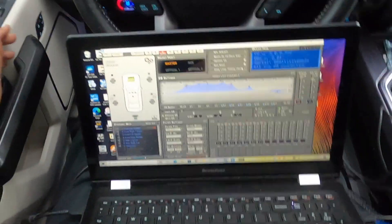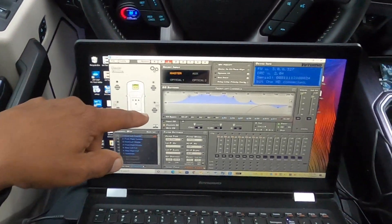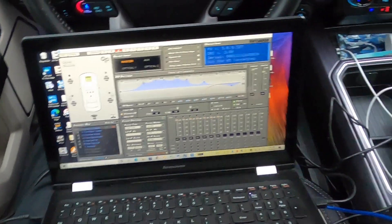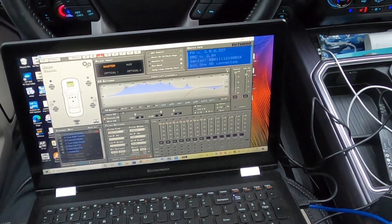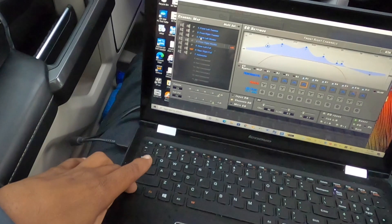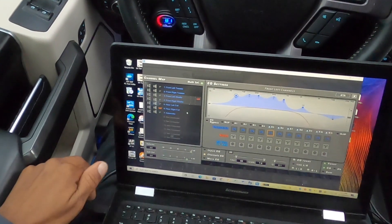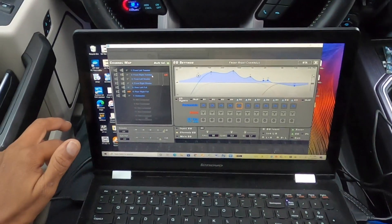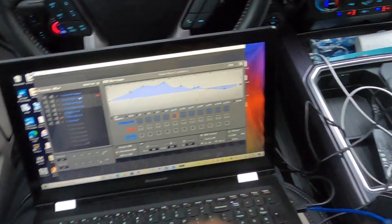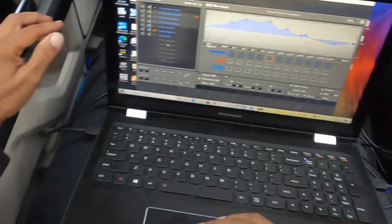When I do an EQ for a car, we set up certain configurations. We did an optical input and the customer has a sub level control from his DRC. You can see this is just the front speaker by itself — this is how we EQ'd it. You can see how we did the EQ for the front left tweeter, and then the front left woofer, or front mid-bass. The right side is set up completely differently. We lowered the tweeters a little bit on the output side.